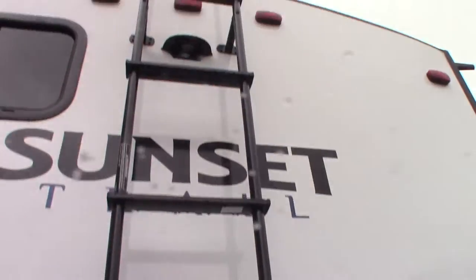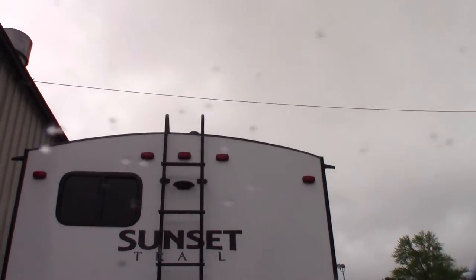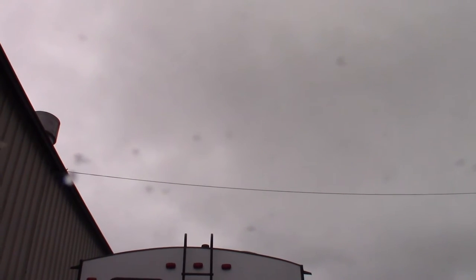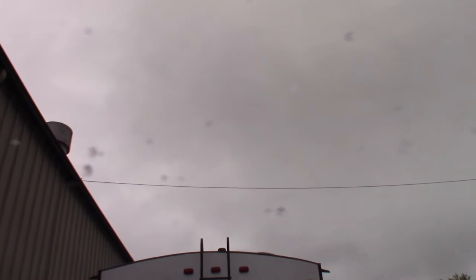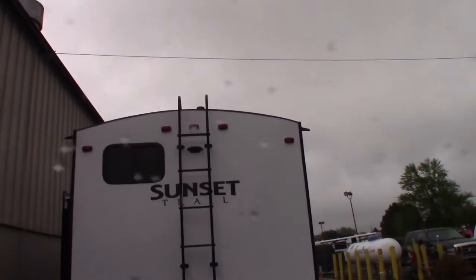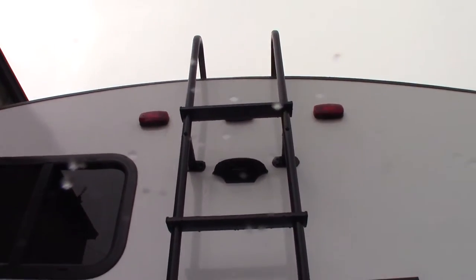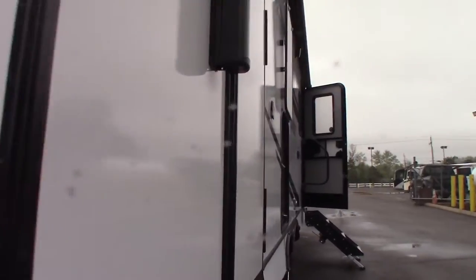You've got a ladder so you can go up on the roof. Keep in mind that you need to inspect your roof every 90 days, as the manufacturer recommends — go up in the spring, middle of summer, and fall. Look for cracking or separation at the sealant, and look for damage from road debris or low branches to your roofing material and vent covers. If you see something, get it taken care of immediately. This housing tells us it's pre-wired for a backup camera, which you can get here if you're interested.